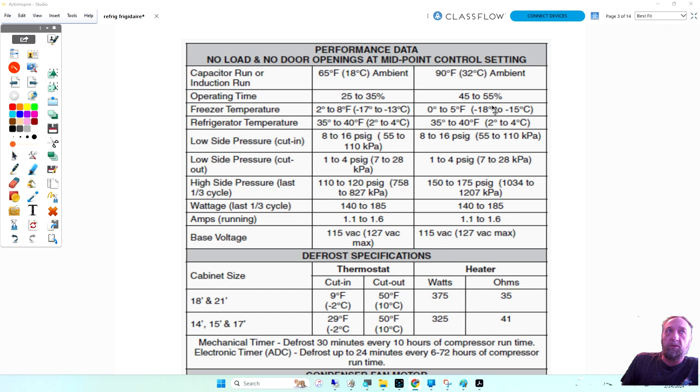Well, that's impossible, because refrigerators do have a defrost cycle. So it's not always running. And if it always ran, it would freeze the refrigerator. So always running to them is every time they walk by, they notice it running. But if you look, we could have a 60% runtime if you're in a warm weather environment or it's summertime or something like that.